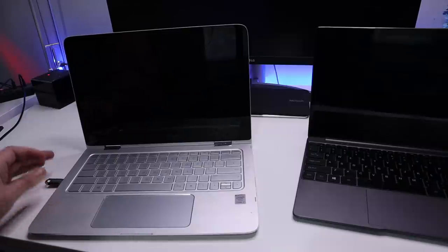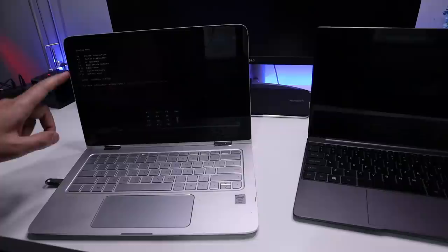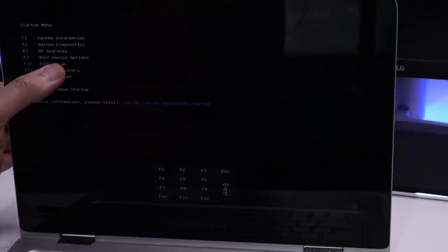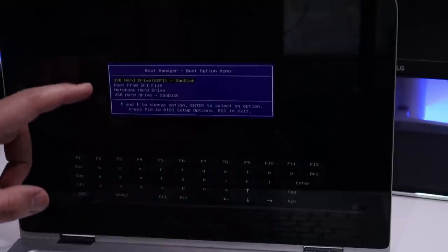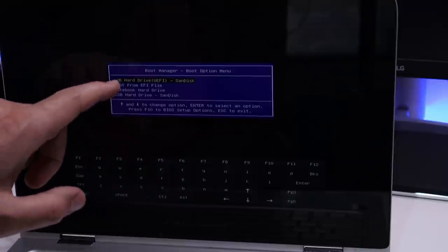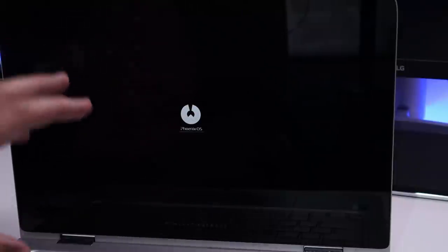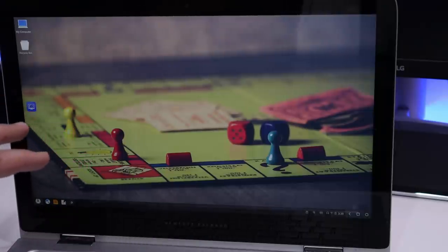On my HP laptop, when I plug the USB stick in and turn it on, if I keep pressing the Escape key I get a startup menu. I can see a couple of options including boot device options, which for me is F9. Pressing that gives me a boot menu asking which device I want to boot from - USB hard drive, notebook hard drive, or elsewhere. Since Phoenix OS is on our USB drive, I select the USB option and press Enter. That will then boot into Phoenix OS. You also need to disable secure boot in your BIOS, which I'll show in a second. Once the device knows to boot from the USB drive it boots into Android OS without any issues.